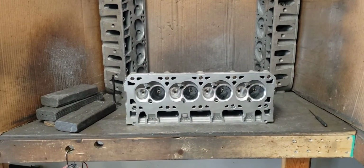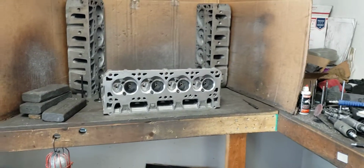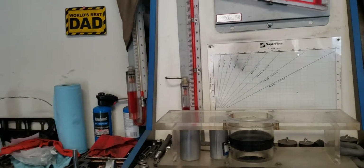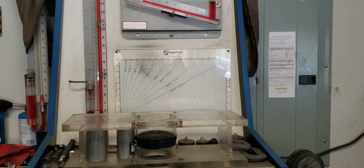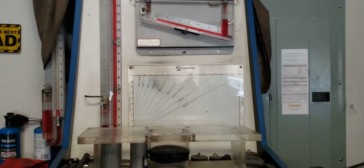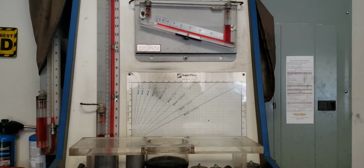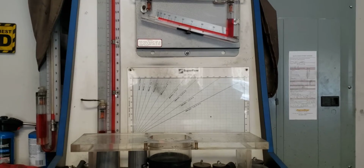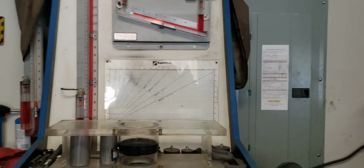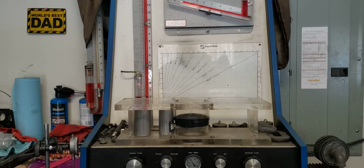The problem with that standard is simply that maybe it's true. However, an engine is a dynamic running machine. It doesn't have constant flow, so it's not seeing 28 inches of depression at any given moment. There are a lot of factors going into that. What is important with airflow and using a flow bench is being able to maintain the rates of flow that you find and being able to show differences. Just remember that every flow bench is just like a dyno. It's particular to that setup and that person, how they run it.